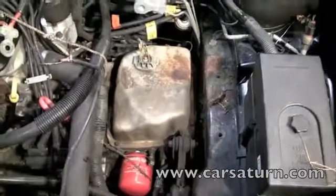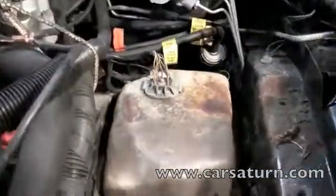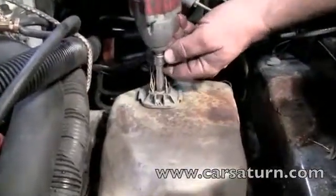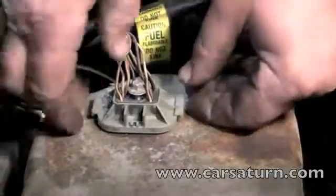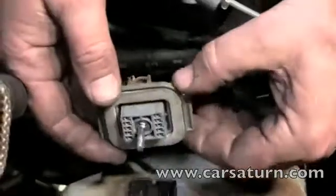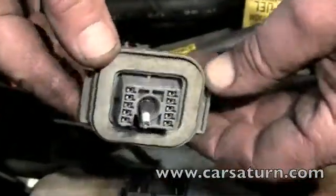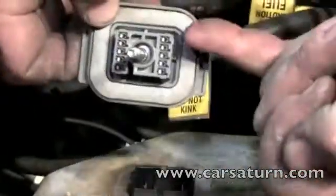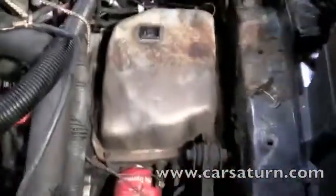Gently push the wires out of the way on the transmission dome cover to expose the 7mm bolt. Once we have the bolt loosened, remove the connector and inspect it very carefully. All the pins should be bright and clean. If there is corrosion or dirt, the transmission will malfunction. Also, inspect the other side of the connector. The same applies to it.